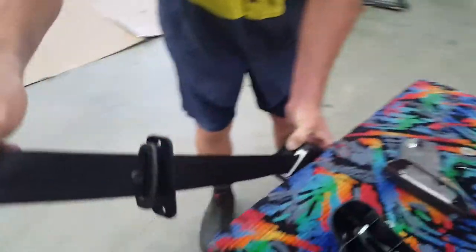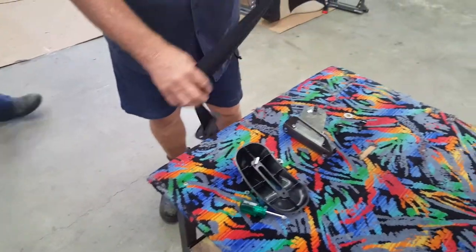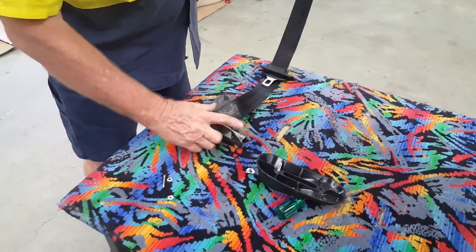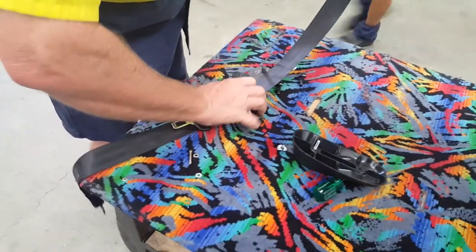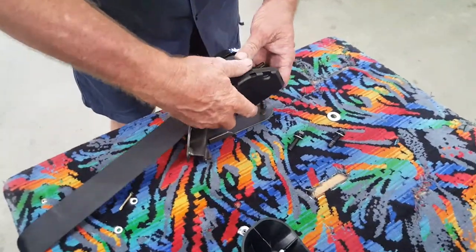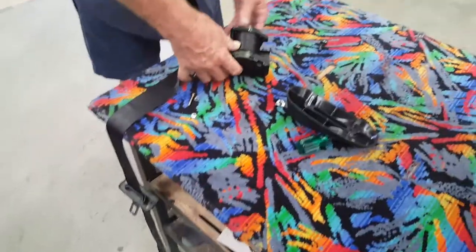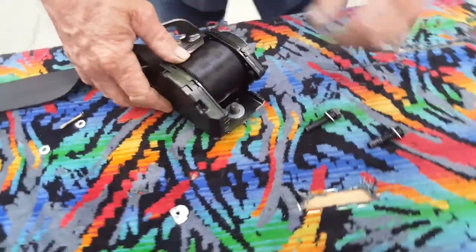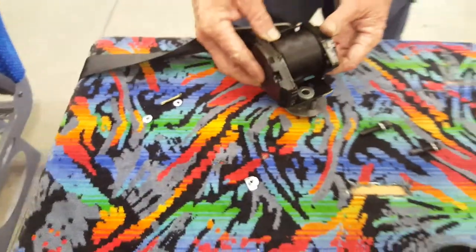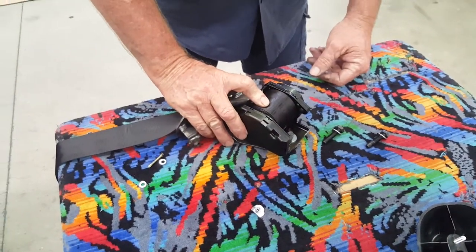By finding the flat area, we can put the seatbelt on a 45-degree angle to pull the seatbelt out, hanging on to the rear itself, and then slide the seatbelt through the steel sash guide mount by putting all the components through there and locating the back hole. There are some pins in the little holes. So as we do it up, we can just do it up loosely for the moment, and as we get closer we'll then make the adjustments.